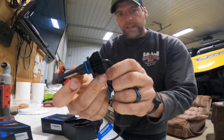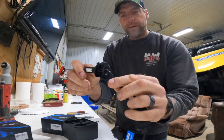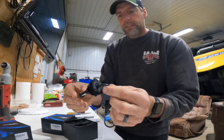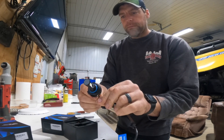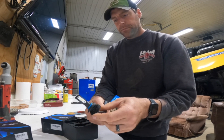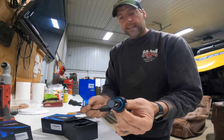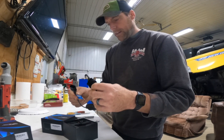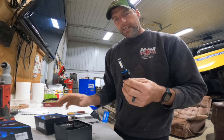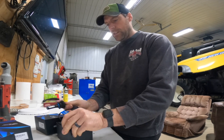On the back of the LED you can see it's just a big aluminum heat sink, and that's what dissipates the heat generated by the LED bulb. A lot of them have little fans, which works well if you're sealed up, but probably not in an agriculture application with a lot of dust and moisture. I think this fanless design will last longer. These headlights are the 9005 or HB3 style — they're very common.